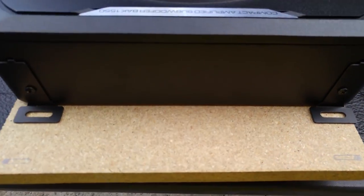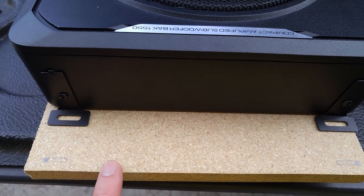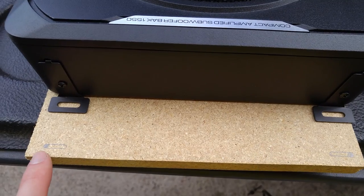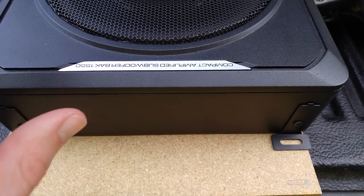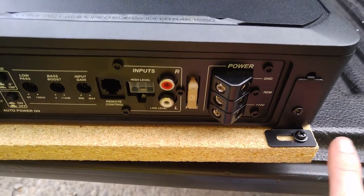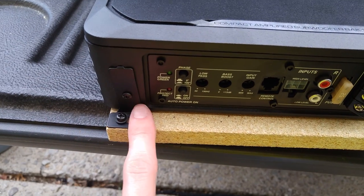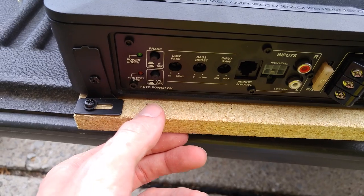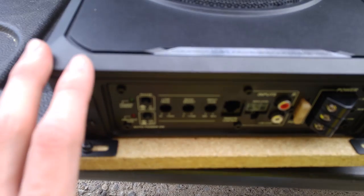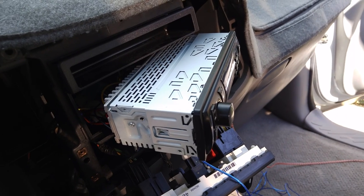After starting to wire everything up for your sub, take it back out. I've read it's good practice to mount the sub onto a piece of particle board to reduce noise. I measured where to put the screws, drilled four holes — two on each side — and bolted the sub to the board using the little stands that came with the kit. The board is about five-eighths inch thick; I piloted the holes and put screws in all four corners.